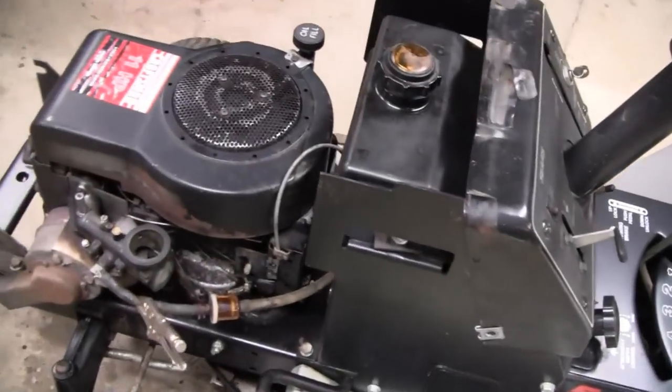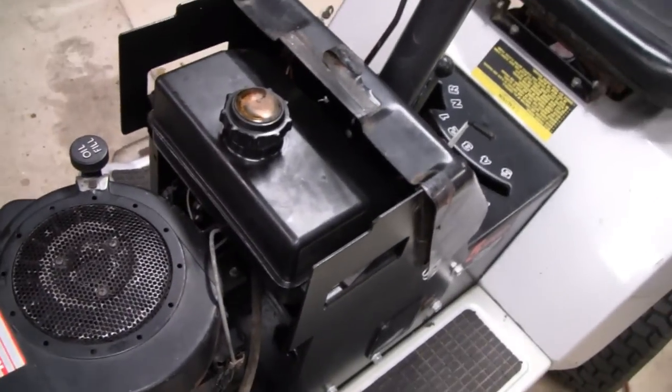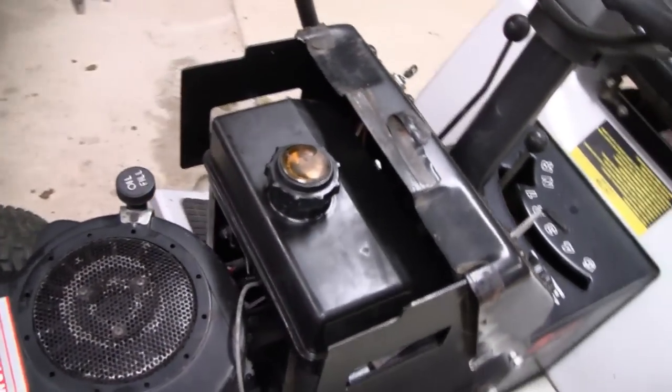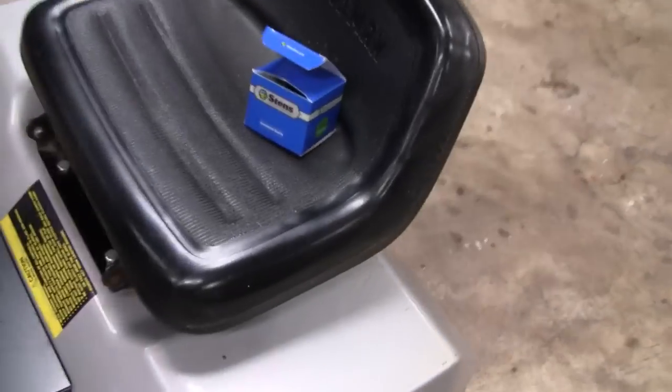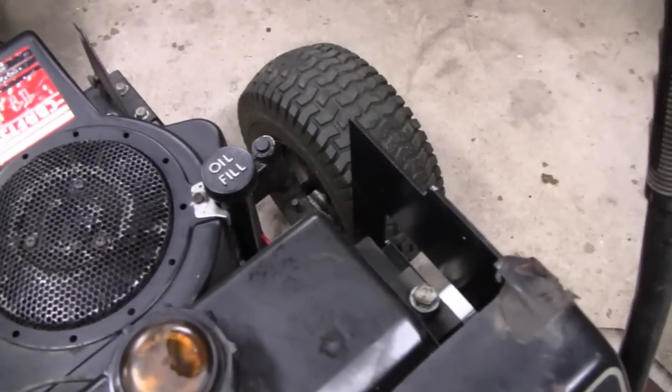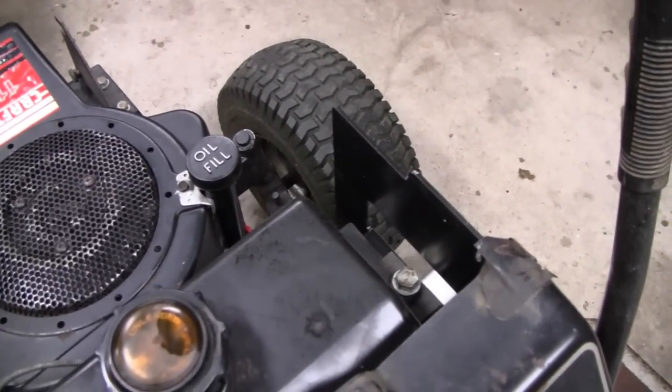But anyway, I don't know if you remember, but I was having trouble with the solenoid. You know, it was clicking and clicking and clicking and wasn't turning. So I bought another one. You know, it figures that now, if I try to start it, I got the spark plug unplugged, but look, the solenoid's working good now.